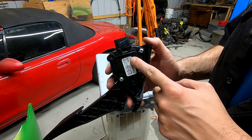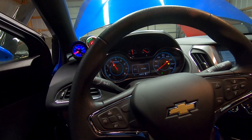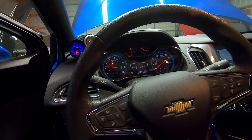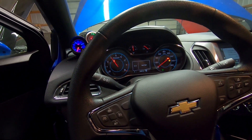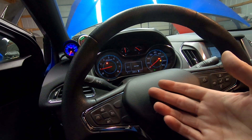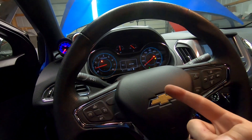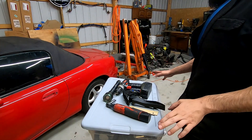You can see the position sensor is now in a different spot, so let's go test it on the car. I put the pedal back in and I just want to show you how the car idles and the throttle response — just to show that it doesn't cause any damage, you're just adjusting your throttle pedal. One might think that turning back the adjustment on the throttle would cause some sort of lag — let me show you what it does. We have no check engine light and no throttle response issues. Let me pull the throttle back out and show you the cheap trick.